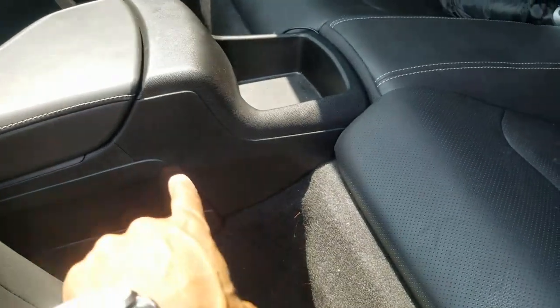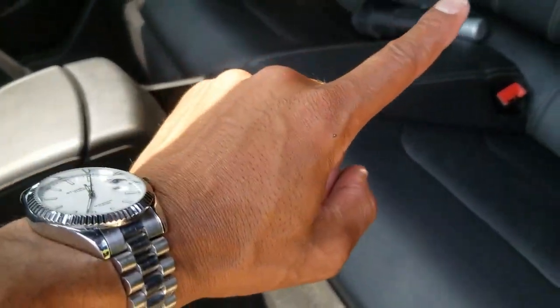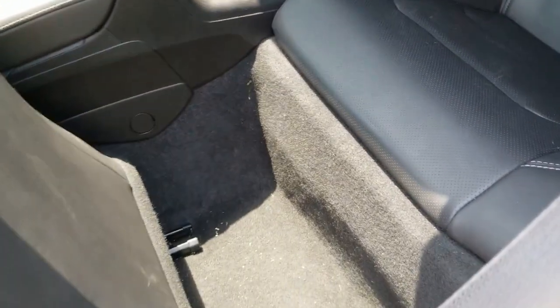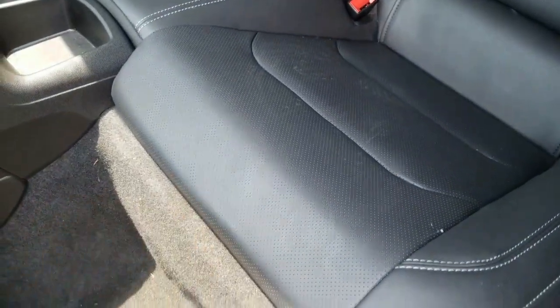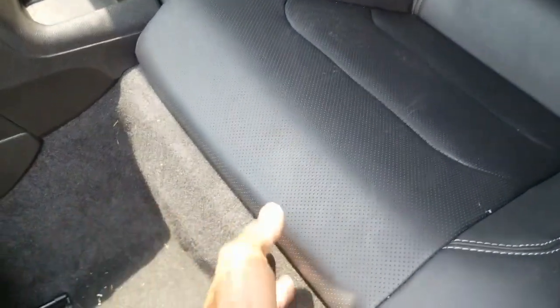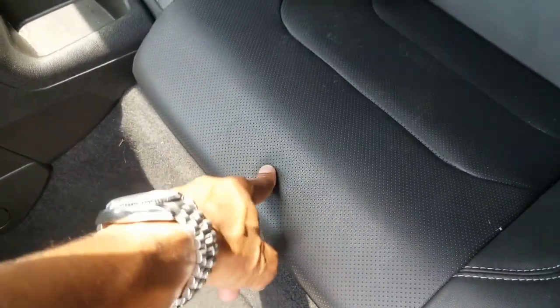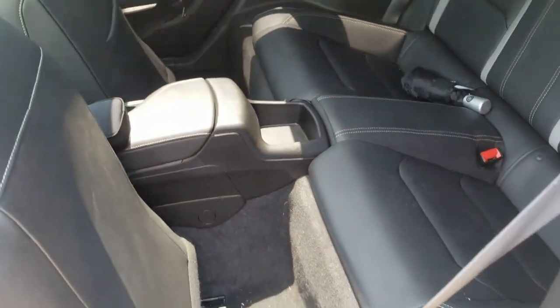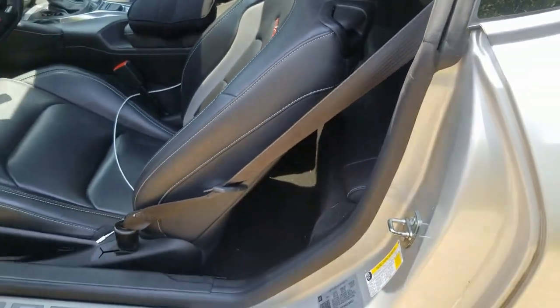The console and the seat touch, so running the wire to the back — all you gotta do is lift the seat up and the wire goes straight under, no problem hiding it. The seat comes up like every other Camaro or Impala seat — just lift up real hard, there's one push-clip on each side. It's a little tough but once you pop that up the whole seat is up.